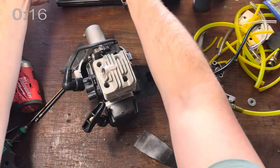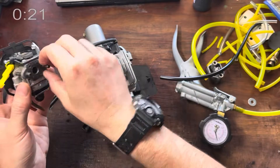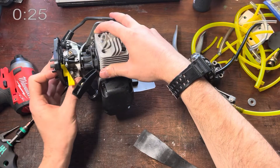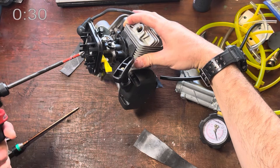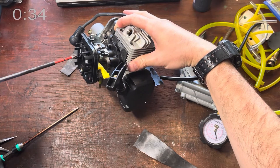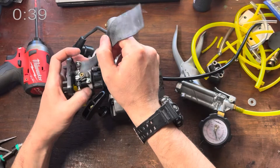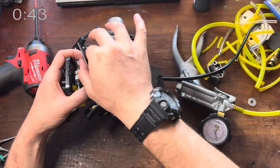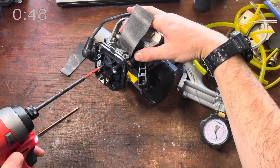Take your carb, like this, and pop that onto the intake side. This is going to be a block-off here. Do that with the impact wrench, impact driver, just so they don't fall back out. And then we're going to pop this inner tube between the carb and the manifold, and we're going to snug it down on both sides.